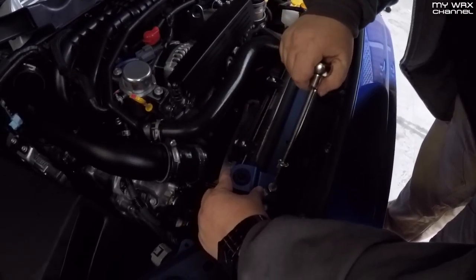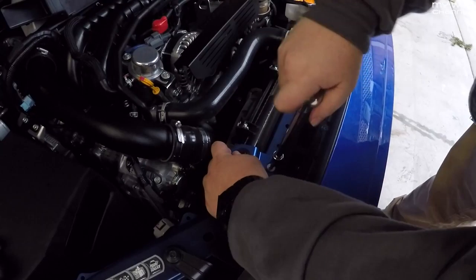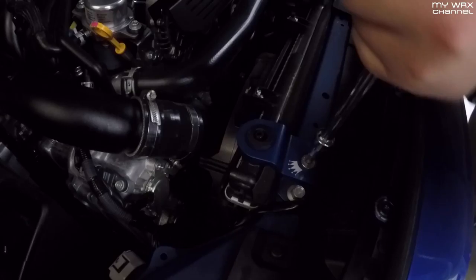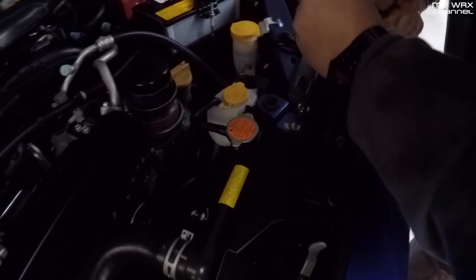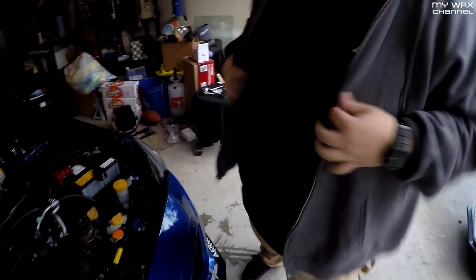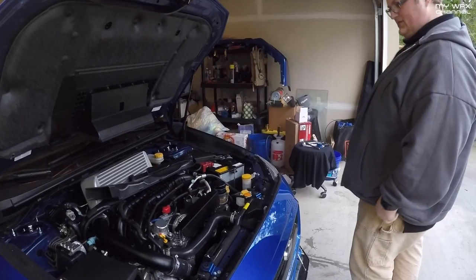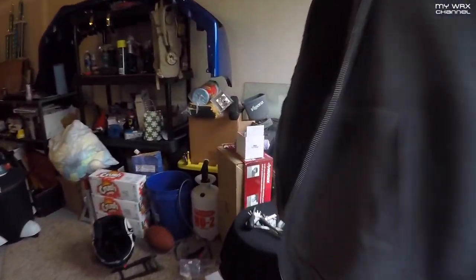Here's the second one — just going to slide over the post on the radiator, under this piece of plastic, and drop the new bolt in. Get it started by hand. It's going to pull the radiator in a little bit as you're tightening it up. Now just give it a little snug. Snug that one up all the way. That's all right there.